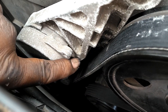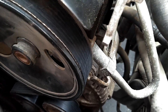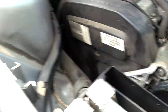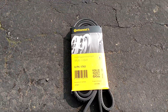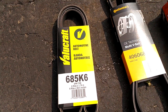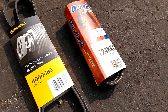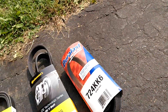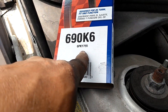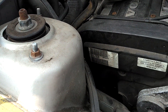Release the tension pin — the tensioner moved up. The belt is nice and tight. If you didn't have the belt on there, the tensioner would come probably twice as far as it is now, so it has decent tension. These are the belts that we tried: we got the 1743 from FCP, the 1740 from AutoZone which didn't fit — it was too short. This 1840 is for the RN engines, it's a double-sided belt, and I don't know why they had it listed as fitting on the '98 car. So we ended up with the 1755. Would have preferred a 1752, but we're good to go.